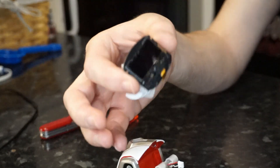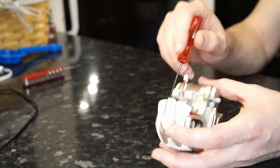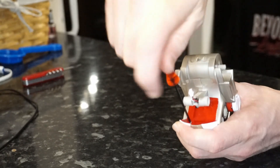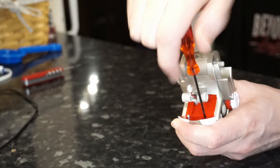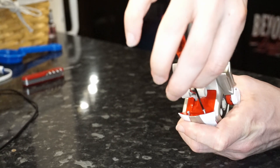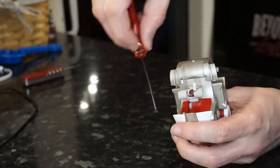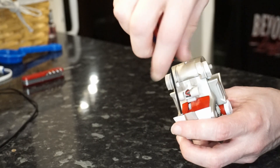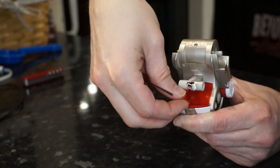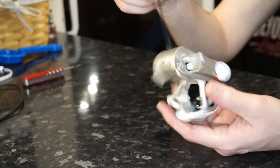It makes sense to work with this in sections, so keep all the head parts together, and the wheels and the arms, so you can work backwards. Moving on to the little red backplate cover that sits behind the head — there are two more screws holding that in place. Take your time when taking these out, because the last thing you want to do is strip the screw. Get that little red backplate off — it just slides off; use a spudger if you haven't got any fingernails.